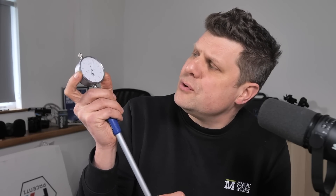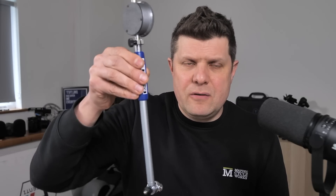We set this end at 42 millimetres using various spacers and washers, then use a set of micrometers to squeeze it down to 41 and set the gauge to zero. That means as we meet a restriction we press into here, and we're measuring the amount going underneath 41. As we release pressure — i.e. the bottom bracket is getting oversized — that measurement gets bigger. Rotating around the entrance to the bottom bracket, it's very easy to see the ovalization effect taking place. These are normally used for measuring the inside of engine bores.